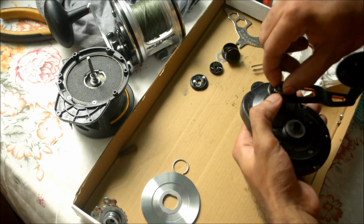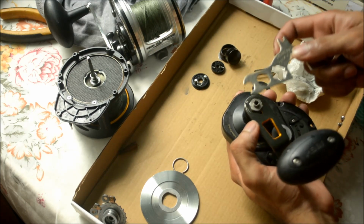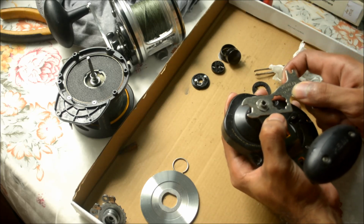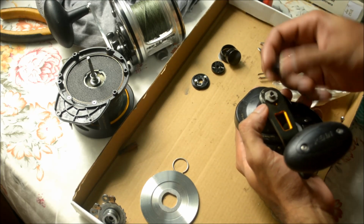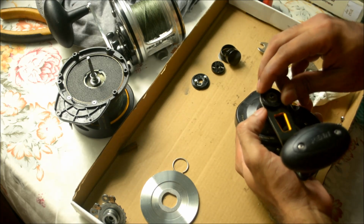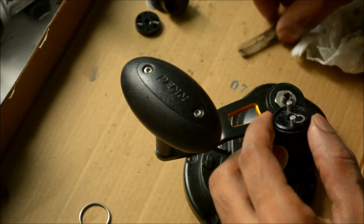What you want to do is pay heed to tightening it. Make a note of the original position of the nut when you take it off, and mark it, because there's a little hole that holds it in place at the base of the clip, as you can see there. So you just want to align that, and once that's done, you get into the shifter.